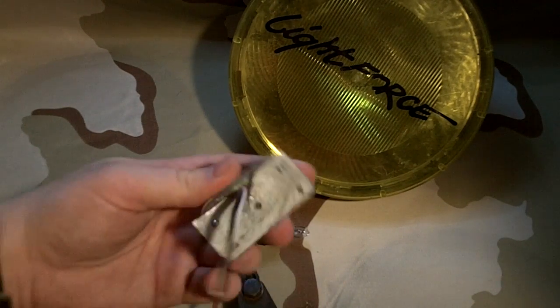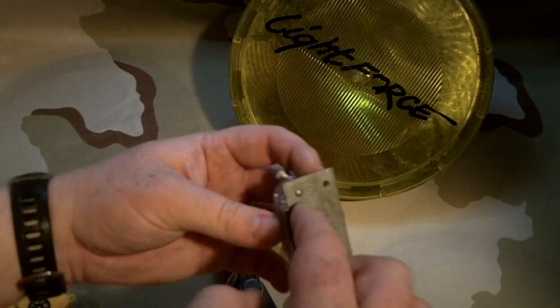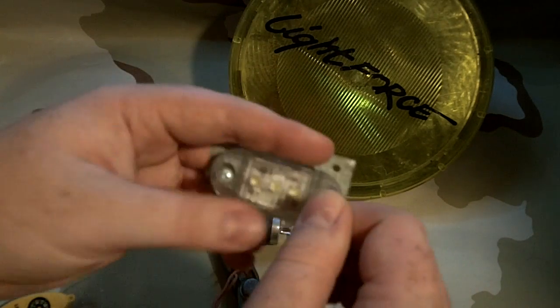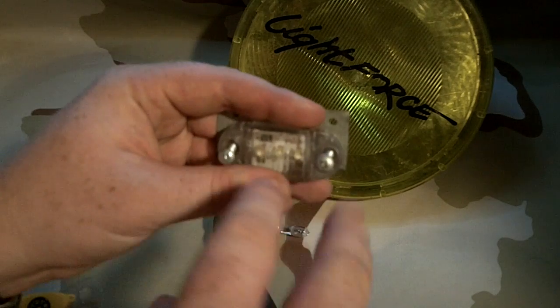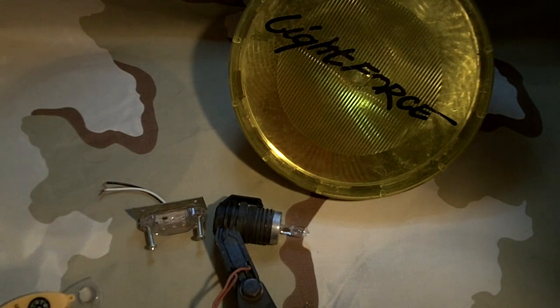What I did, and you'll see in the pictures that I roll in, is just took some of that flashing that they use to reinforce 2x4s and just cut it down. And I think I used shoe glue on it, just so the screws had something to bite into, because there's no nut or anything on the back. The way the Scout marker lights come in, you have to get that tab pulled out and screw them in from this direction, so I just needed something to bite on the back. So that pretty much takes care of the lighting of the Scout.